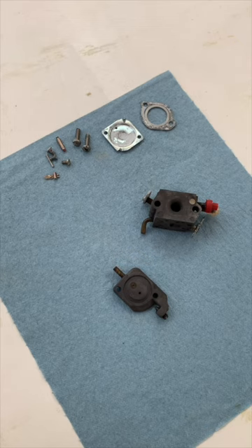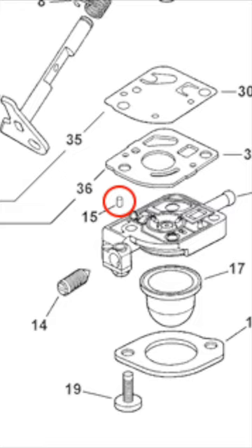After running this disassembled leaf blower carburetor through an ultrasonic cleaner, I noticed a tiny plastic plug among the other parts. Thinking that it must serve some purpose, I hung onto it — and it's a good thing I did. Turns out it's a tensioner that holds the idle adjustment screw in place. Without it, the screw would turn freely from the engine's vibration and eventually fall out.